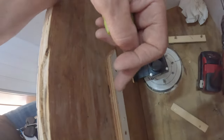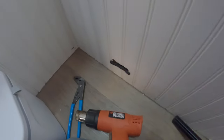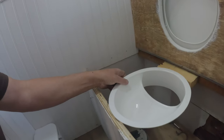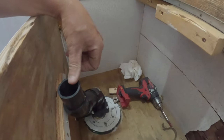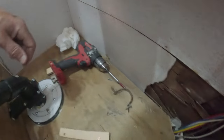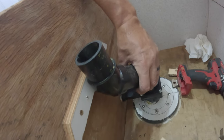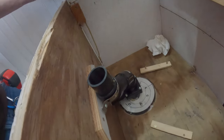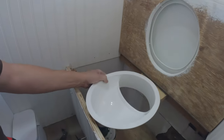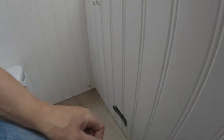Now I've got to figure out my upper pipe — double check my length, give it a trim, and we're almost back in action. That kind of actually blocks up the hole pretty nicely. Trial fit of the diverter — it sits in there nice, I got the height right. I trimmed close to two inches off it. I don't have it glued in yet to the valve, and I'll have to put my little strap on there to hold it in place, but I think I'm ready to glue. There is the completed setup — all glued together, clamp back in, just a piece of strapping, everything lines up with the diverter seat.